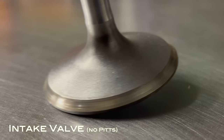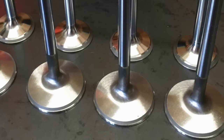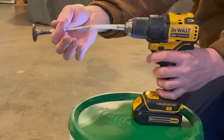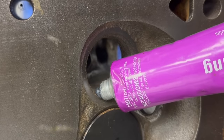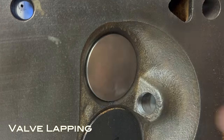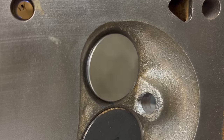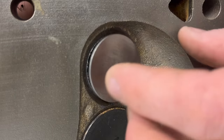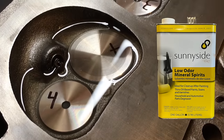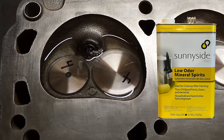The pitting on the valves interferes with valve closing and seating well during the combustion cycle. If they don't seat well, you won't have good compression and engine performance suffers. New valves won't just seat well right out of the box either — just like piston rings need to wear to cylinder walls, you want these valves to match the valve seat. Typically you'd do a three-angle valve job and regrind the valve seat. To save money, I lapped the valves to the existing seats: you apply a lapping media — think of it as a wet, gritty sandpaper paste — then rotate the valve against the existing seat until they wear together. To check it, reassemble the cylinder head, fill the combustion chambers with paint thinner, and let it sit. If the paint thinner sneaks by the exhaust or intake seat into the ports, you know you need to lap it more.